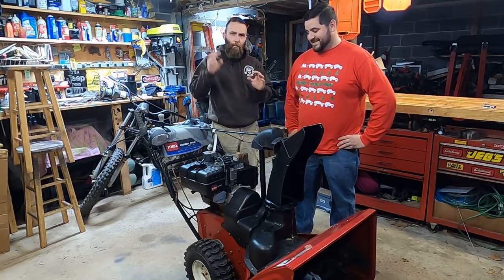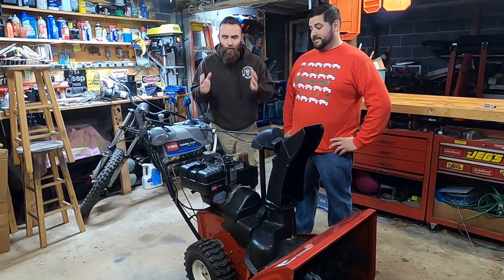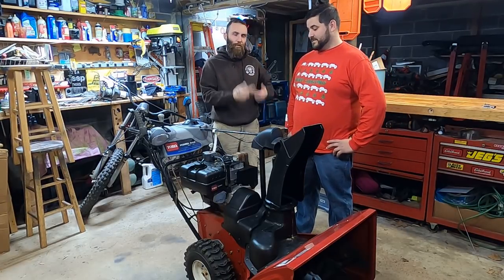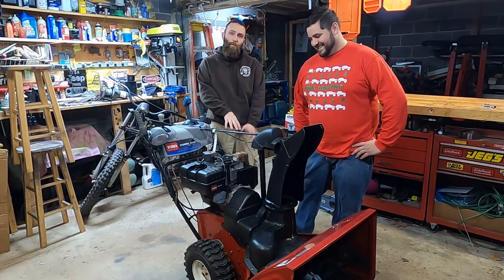It stopped in the middle of using it. I put fresh gas in it. I put a fresh spark plug in it. I just don't know what the problem is. The only thing we've done to it, we popped the float bowl off just to confirm our suspicion, and as Eric would say, it was full of crustaceans. So we know the carb is going to be part of it.